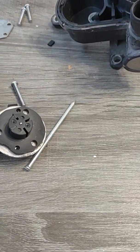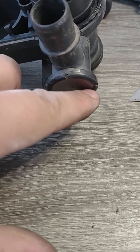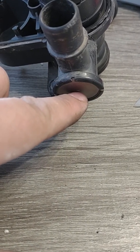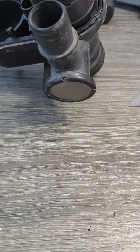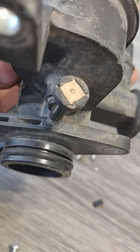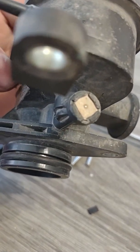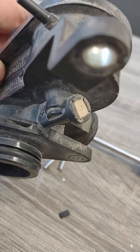Now when you've got this apart you're going to do a couple of different things as well. Right here you're going to seal this. I'm not going to tell you what to use because honestly I don't know, but you're going to want to seal this because inside there's an o-ring and the vacuum can actually leak. And then there's another one too — this little baby one right here. This one tends to crack, so if you pull this apart you'll see there's an o-ring inside there that cracks and then you have leaks through here. Seal this — silicone, JB Weld, whatever — just seal it so nothing goes in and out of there.